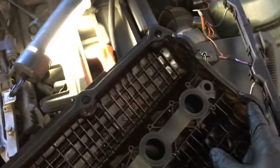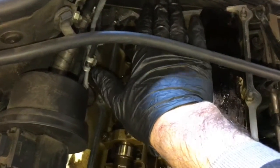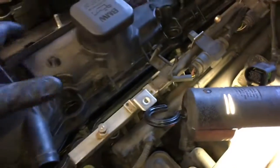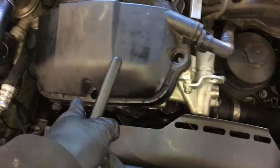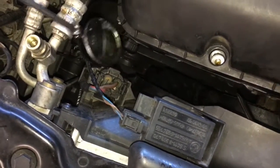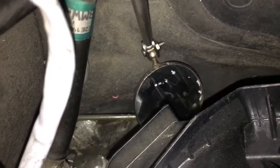When reinstalling the valve cover, the cam lobes have got to fit directly into these little half-moons here. Hold the valve cover up floating as high as you can and then drop the valve cover straight down. Once you get it lined up, drop it straight down like that. Then check and make sure the gasket sealed into the moons and that nothing got caught in between the gasket. Before putting any grommets and bolts back in, take a dental mirror and follow the valve cover all the way around — especially in the back corners where the gasket likes to fall off the most. Use a dental mirror and flashlight and thoroughly check that the gasket is in place all the way around.